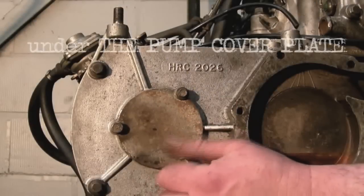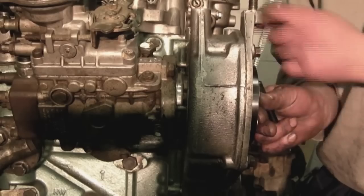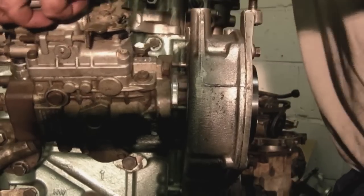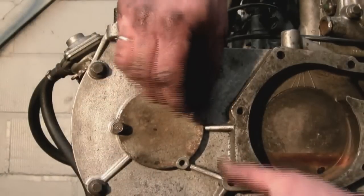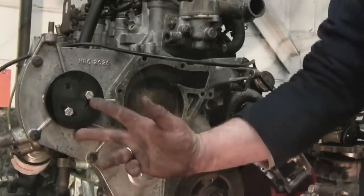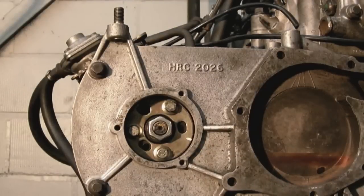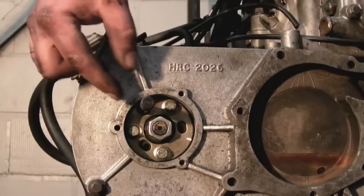Looking at the driver's side of the engine, you have a cover plate with the pump pulley wheel — handy for fitting the tooling and holding the pulley wheel in place while you draw your injector pump off. This saves you having to strip the timing belt case out. There's a handy little slot here — you can see that's the support tool. Removing the cover reveals the front of your timing pump with three bolts and the locking plate. Drop your timing pin in.